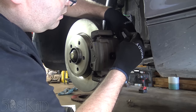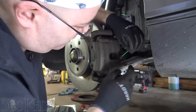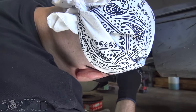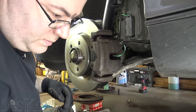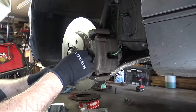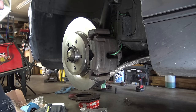We'll route our new sensor up in there where it's in that little cap. You just want to make sure that the sensor faces the pad and not the piston. So the sensor needs to face this way. Don't forget this little clip — I seem to always forget it. So now we're done with the fronts. We'll just jump to the backs and then we'll be done.